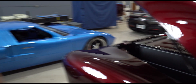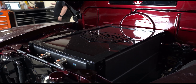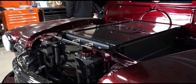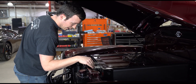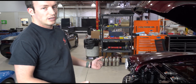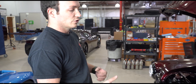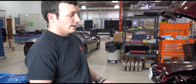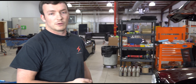We're going to go up to the front and look at the battery modules. The battery modules have both high-voltage cables and low-voltage plugs, so we're going to check those and make sure that everything is connected, which it looks like it is. They would have already done the high-voltage cable check on our pre-terminated cables as well, which is to make sure that all of the cables are built properly and that the shielding and the conductor itself are terminated.